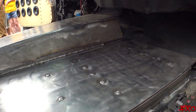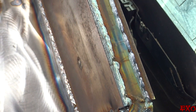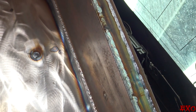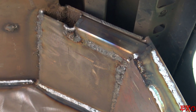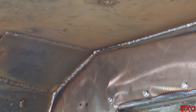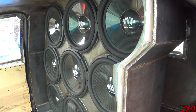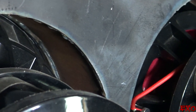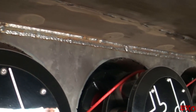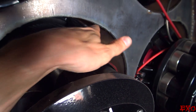This is solid steel! So the floor is a piece of quarter-inch thick steel plate, and then the sides are a piece of 3/16 steel plate with a steel frame, and then another 3/16 steel plate welded on the inside like a composite structure panel. The baffle is a piece of quarter-inch thick steel plate, some 14-inch diameter tubes for the subs to slide through, and then another piece of quarter-inch plate on the back. So the baffle is a total of four and a half inches thick. You can see that there's steel going around the whole edges.